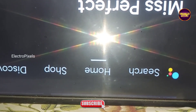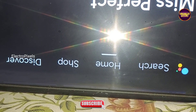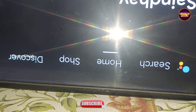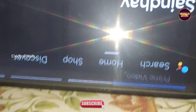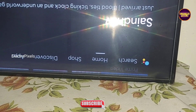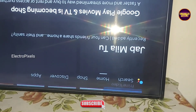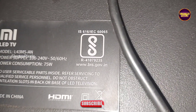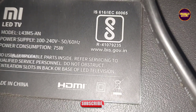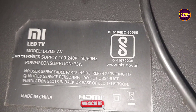As we discussed earlier, these types of panel display complaints are mainly because of internal shorting in gate signals inside the glass panel. If both sides gate signals are short then it's difficult to repair. If any one side of the panel is short, there is a single chance to repair this panel using a temporary panel short removal method. That's only a temporary fixing method — permanent solution is always panel replacement. See this as the TV model number.